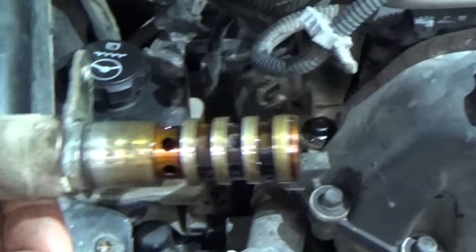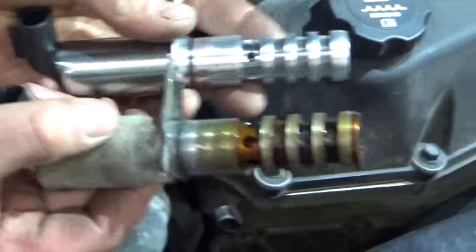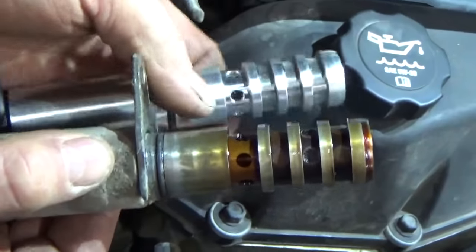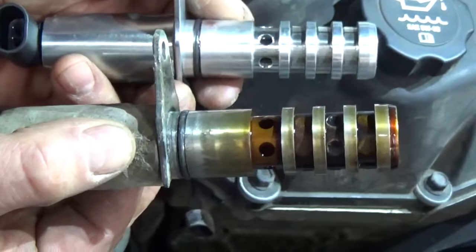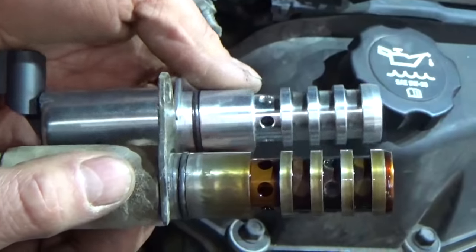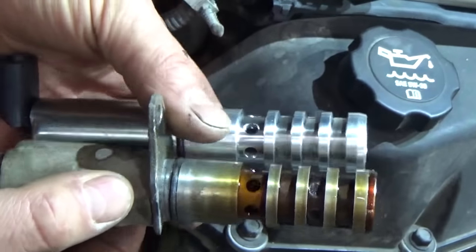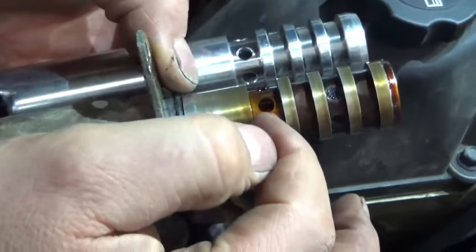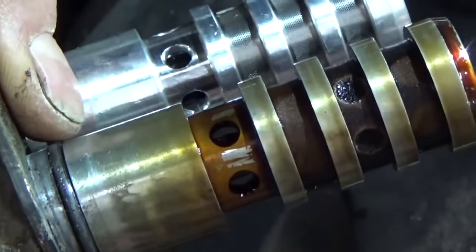And as we look at this one, I do have a new one, because again, with this vehicle we're trying to prolong the life of it, and if it's got a bad timing chain or any of the components down there, they've already decided they're not going to put the money in to fix it. Pulling this one out, you can see it's had a diet of petroleum-based oil all its life. We can see the varnish buildup right there. It's that kind of tannish stuff.